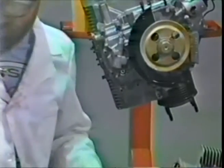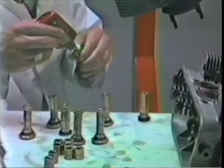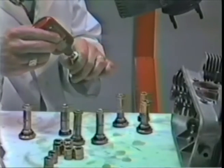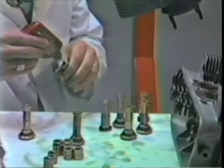You can get out your blue Loctite. We use blue Loctite on the head bolts, head nuts. Put a drop on each of the head nuts. I've sometimes used red Loctite way back when, and boy, it does work. I mean, those head nuts don't come loose. They pull the studs out of the case before they'll break loose. At least in about half the situations, half the studs.